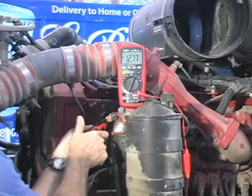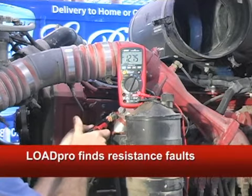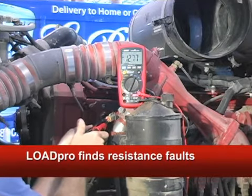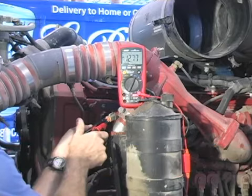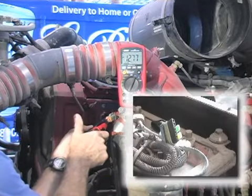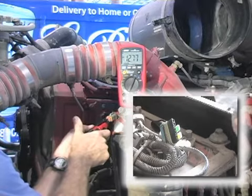Now, just push this cute little Load Pro button. At this point there are two ways this can go. If the voltage doesn't drop, then yee-haw — the wire isn't damaged and you don't have to chase wires. The reading that really makes you money, though, is when the voltage drops, and Load Pro makes them insanely simple.